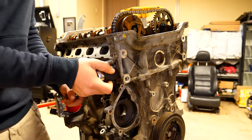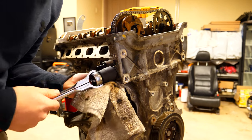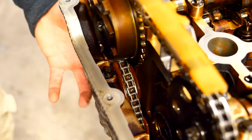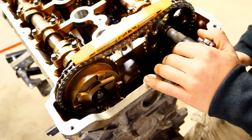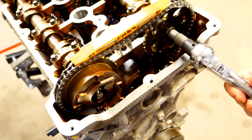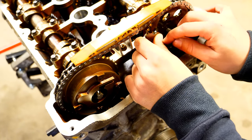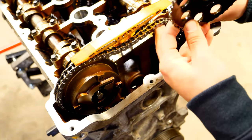On the backside of the motor towards the timing chain, there's a tensioner to remove. That holds up the top part of the left tensioner, which swivels in and out. Once the tensioner is removed, you can remove the slack from the timing chain. With that done, you can remove the exhaust sprocket found on the timing chain — disconnect it and set that bolt aside. Note that bolt is a torque-to-yield bolt and will stretch, so when reassembling you'll need to replace it with a new bolt.